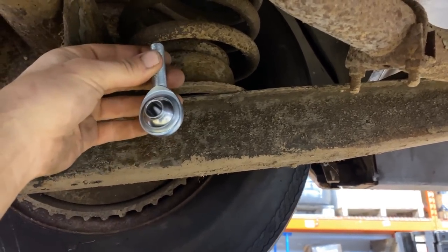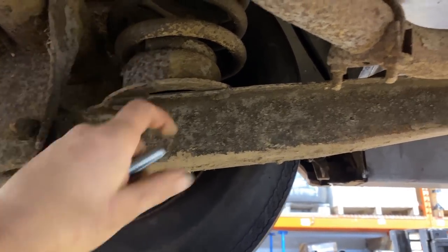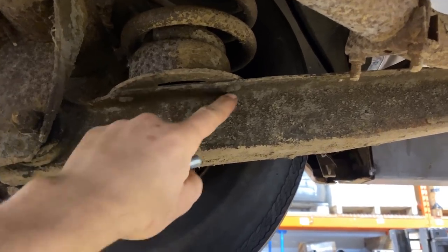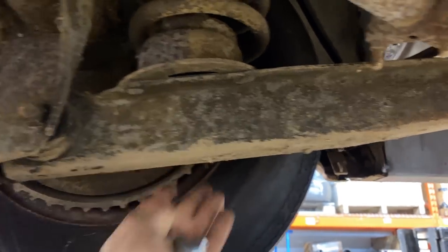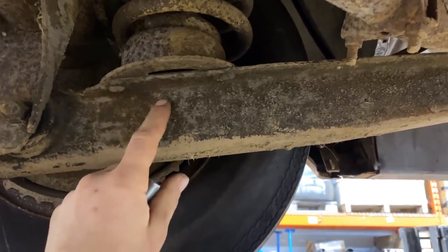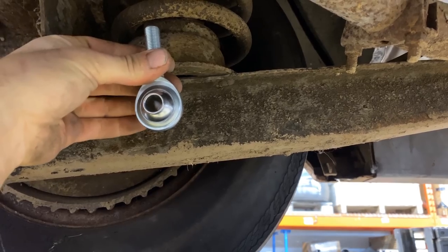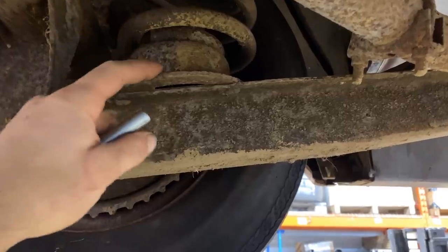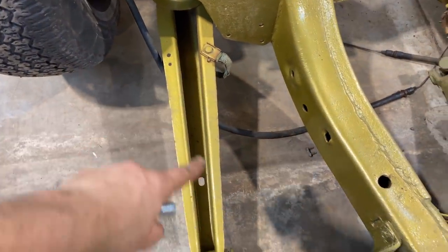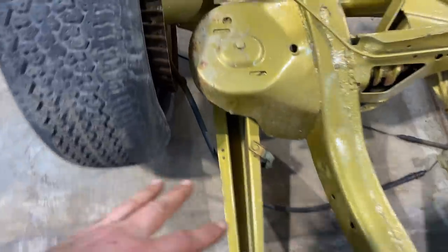And with the coil over the hydraulic cylinder, the coil and the cylinder will go up and down inside the pocket. So in order for me to be able to confidently install this in here, I want to put a doubler plate. So I'm gonna weld a plate on the outside of this and the same on the other side so that it's a little bit thicker material where this bolts in. That's gonna make it strong. And then the top here, this was adding some strength because you can see these are open at the top. Like they've got a little bit of flex. They're kind of flimsy, and I think that's, you know, a bit of a reason.